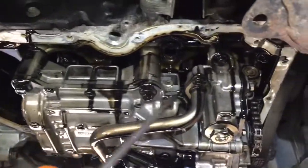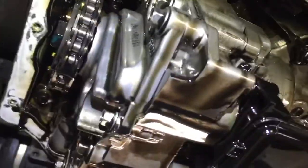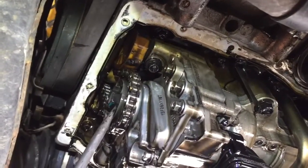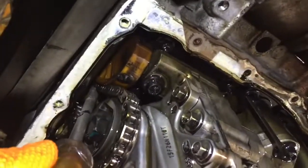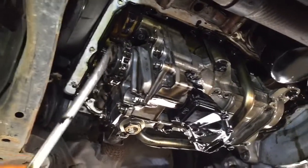I have to disassemble and take this whole piece down and then split the oil pump here and take off the timing chain — by the looks of it. It's not the whole engine timing chain, it's only a chain going from the crankshaft to the oil pump. I'm hoping I can crack that nut and the tensioner will go back when I push on it. Oil is starting to dribble; the chain will come loose if I push the tensioner back and have slack on the pulley, then I can take off this pickup pipe.